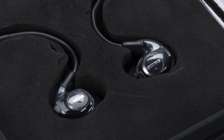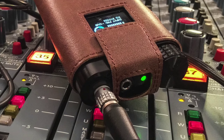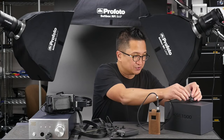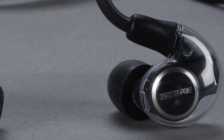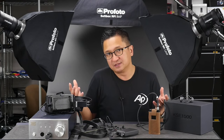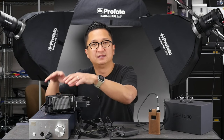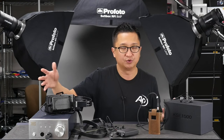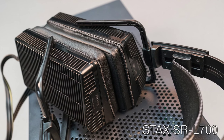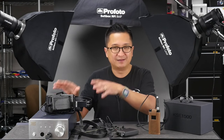As far as tonal balance, I would call it a rich neutral sound — there's definitely a richness to it, but it's on the neutral side for sure. Treble extension is fantastic. It sounds like a good electrostatic system. I will say, though, that it is a closed headphone. You'll see there are essentially two parts in each earpiece: the inside part is where the electrostatic drivers are, and it vents to a larger volume outside of it, but it's still sealed. And it sounds like a closed headphone. Compared to the open-back Stax SRL700, the imaging is wider on that headphone, with a bit more airiness in the mid-to-high treble.